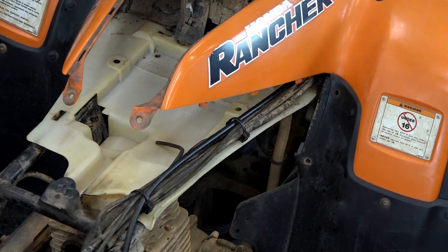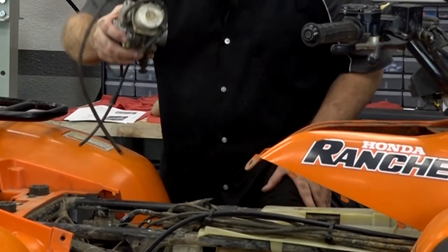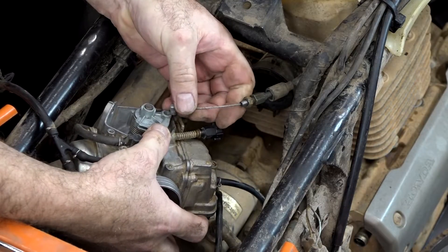Let's start getting this fuel system back together. Start off by getting this cover back in — there's just a couple of push pins all the way up front. You want to put the white plastic under these two other pieces right here. The rest of it just kind of floats in place. Route all our cables and hoses back through these zip ties. Next, let's go ahead and get our carburetor mounted up. Let's start with the throttle cable.